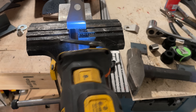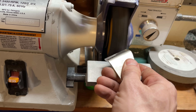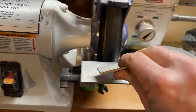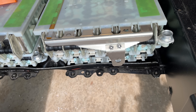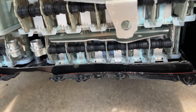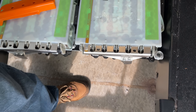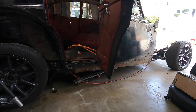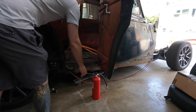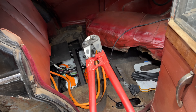I need all four modules connected in series, and to do that I need to connect the two on the right together and the two on the left together. I made little brackets to bolt these together — I'm really just connecting these modules in the same orientation and basically the same way Tesla has, but it's still a little nerve-wracking. I'm just waiting for sparks and fire. Speaking of, let me get this fire extinguisher that won't actually do anything. Maybe also a quick disconnect for my HV cables, just in case.